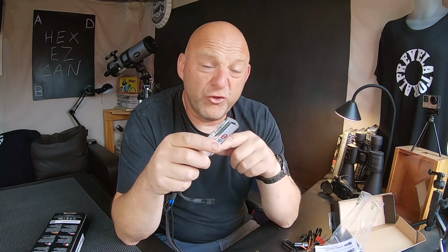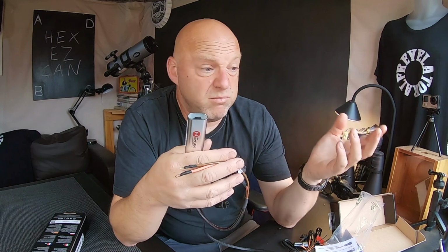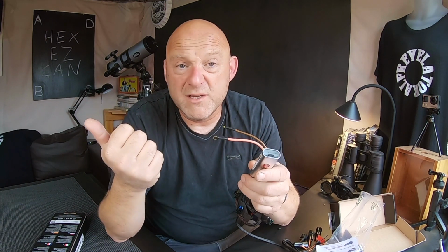For lighting, let's say, or for extra turn lights, indicator lights, they will work flawlessly with your existing switches. So this basically works with your BCM, ECM of your motorcycle with the CAN bus system. And as soon as you flick on a light, let's say, then it also sends the power through this, and it will turn on your auxiliary lights. You can set the brightness of them, you can set any kind of delay on them, all that kind of stuff. Let's say when you're doing turn signals, you've got extra turn signals, you could basically put on the turn indicator and it will go through here and it will set the power to extra turn lights as well. You can dictate if you want auxiliary lights to flash or to go off anytime you put on a turn indicator, or if you want that to blink as well. It's a very ingenious bit of kit, and it's very easy to do it via your computer.